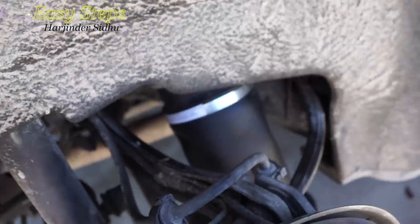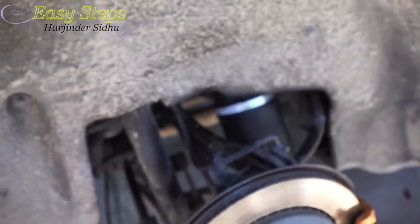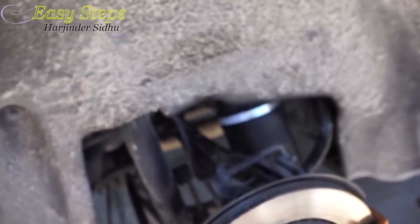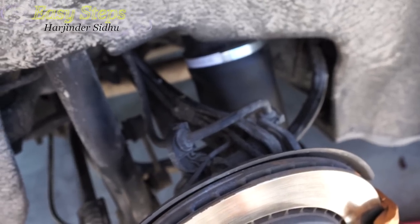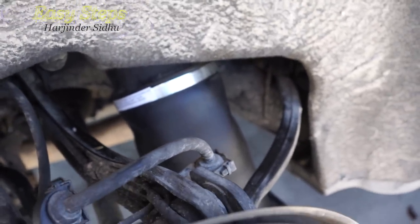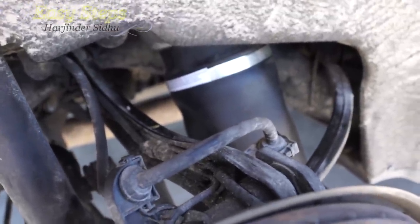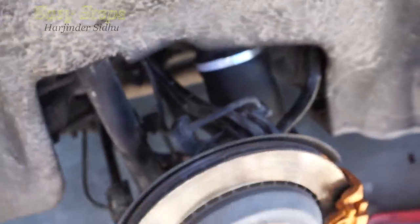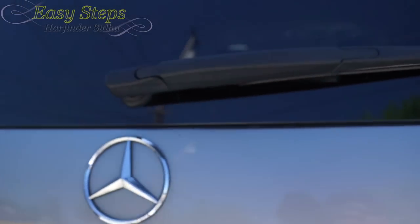There's the new air suspension bag installed right into place. Now I'm going to do the same thing on the other side. Once I'm done, I'm going to put both tires back on and lower the car to the normal height level. Then I'm going to go back under the hood, put the 40 amp fuse back in, and turn the car on. After a couple of minutes the air compressor will kick in and the bags will start inflating. Once the bags are fully inflated, you will hear the air compressor turn off. Then you can take the jack completely out. And that's how simple and easy it is to change your air suspension on your Mercedes-Benz GL-Class X164.